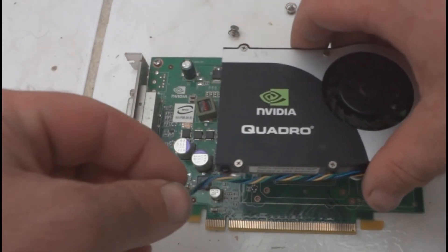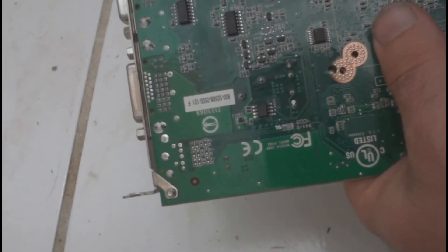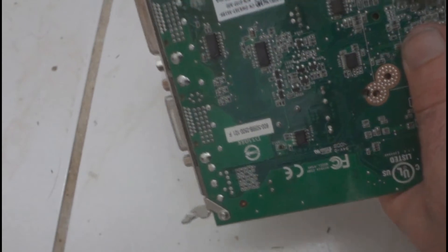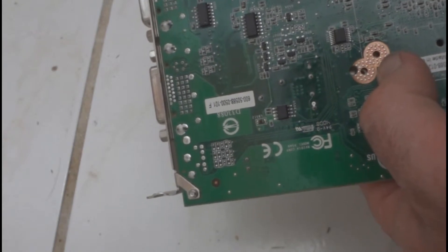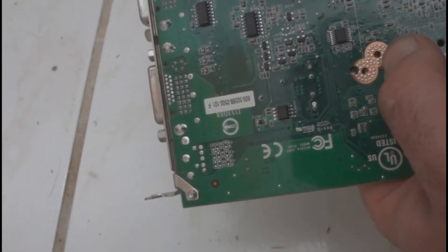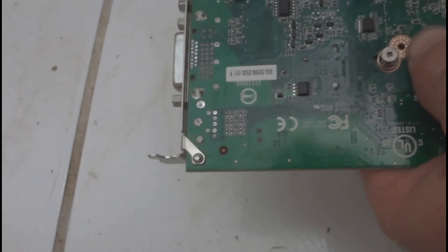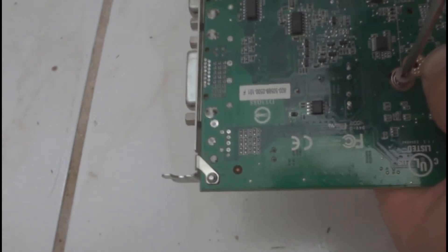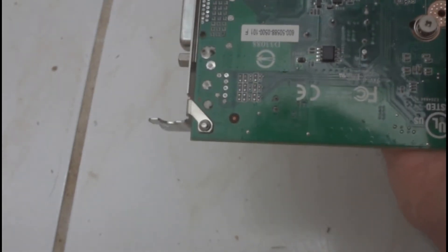Make sure that you put the fan and heatsink back on the correct way. After you get the heatsink on there, hold it carefully and then turn over the board. When you move it, you can see when the hole lines up so you can put the screw in. Get the first screw in and press down on the spring. You don't have to snug it yet — just get it in there so it will hold in place.